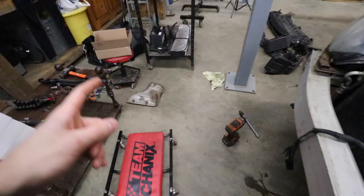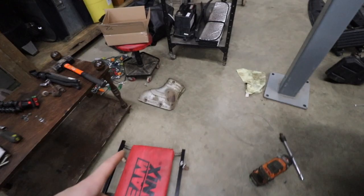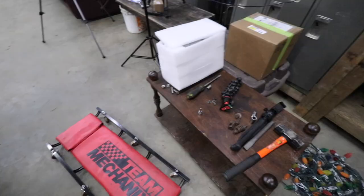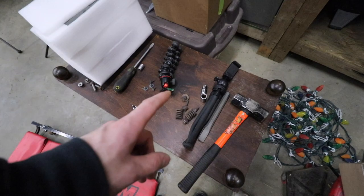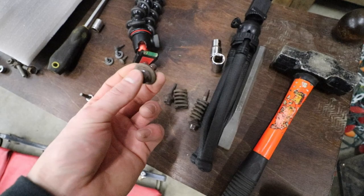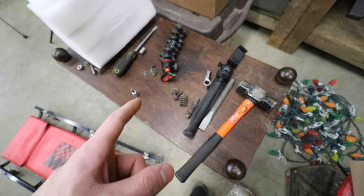I'm one bolt away from getting this exhaust manifold out. We got the heat shield out and I'm so surprised none of those bolts broke. I did take the two bolts off from the header to the rest of the exhaust — the two-bolt connection — one came out and the other snapped, which is okay because we're not reusing them anyway. The bottom mount bolt came out real nice. I've heard that these CX Racing sidewinder manifolds tend to crack because of the weight on the turbo and not having a bracket, so we might rig up something to make a bracket fit onto it.